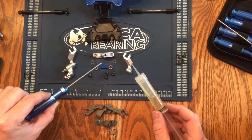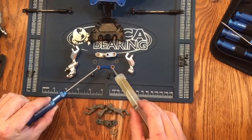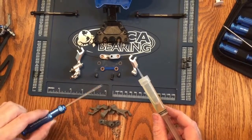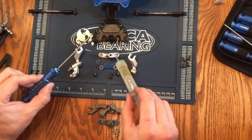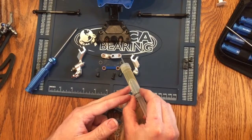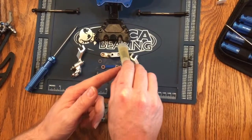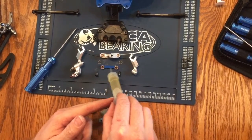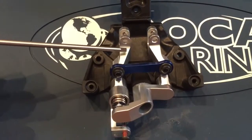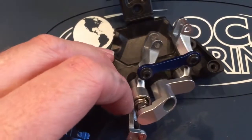All the bearings here have now been replaced. I've used Boca's Lightning Lube to assemble them and pressed them into place. I've taken out all the old bearings and applied Lightning Lube using this really neat dispenser, applying some on the bearings to make sure that they function 100%. These ceramic bearings are really smooth — the video doesn't do it justice. There is phenomenal movement. The bell cranks and new drag link have been reassembled and I can't say enough about how smooth the steering is.